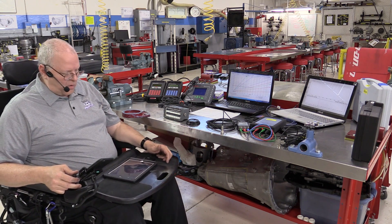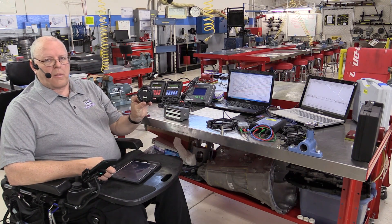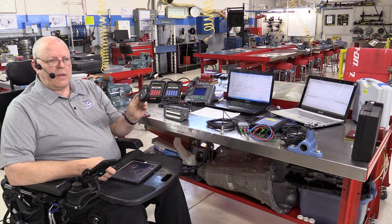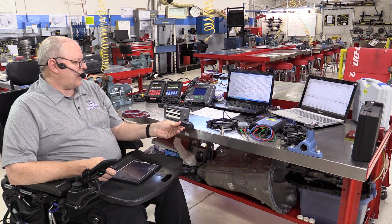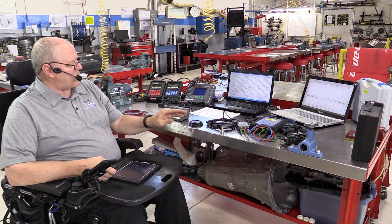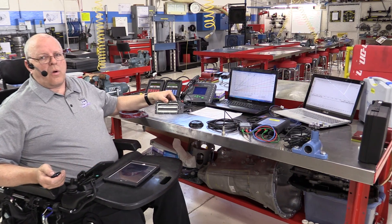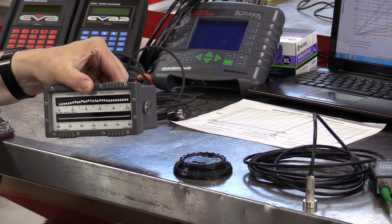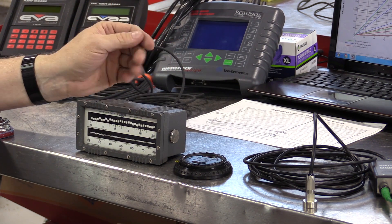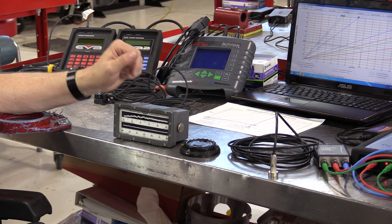Just a quick reminder of what vibration analyzers are out there. There is the Syrometer, which is still available. You can buy it on the internet for around $35 to $40. Briggs and Stratton small engine places use it to set engine RPM. There is also a resonant reed tachometer. I did a video on the Syrometer and the resonant reed tachometer — that was my part one video, along with basics of automotive vibrations.